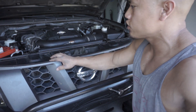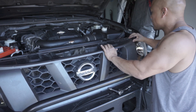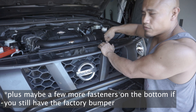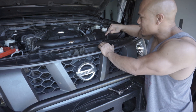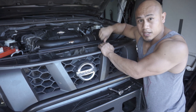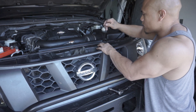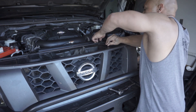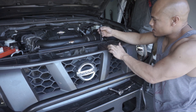If you've never removed the grill before, there are actually four plastic pop rivets that go in here, and to remove them you just use a flathead screwdriver and press them up and pop them off. Now these can be really brittle and break, which is what happened to me, and I never bothered to replace them because I like using zip ties instead. Whenever I want to replace it, all I gotta do is just put it back on and lock it down that way.